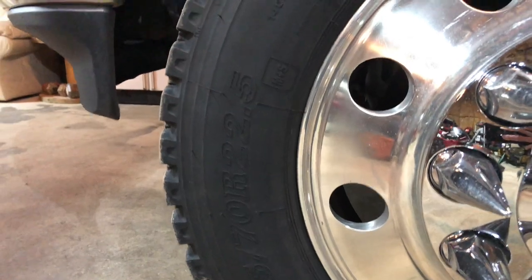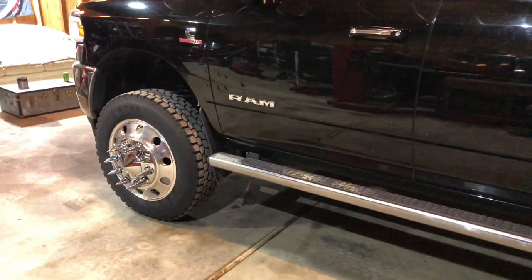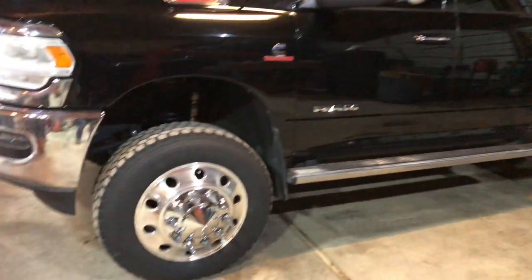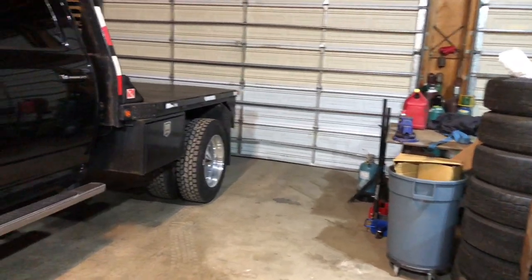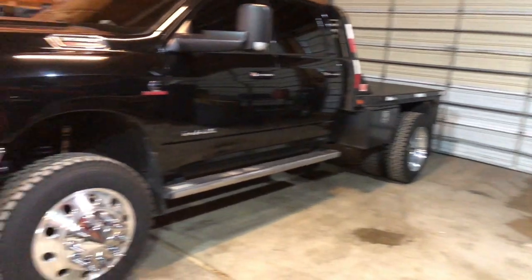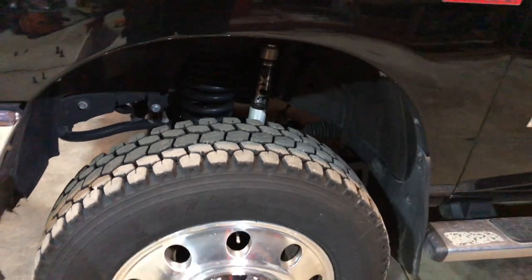What size tires are we going with? The 255/70 R22.5 18-ply — these are some heavy-duty tires. If you're blowing out an 18-ply in a 3500, you're doing something crazy. One reason I opted for commercial grade tires is I was tired of putting mud tires on my truck every 20,000 miles on a 20-inch or 24-inch rim. Regular 14-ply tires aren't rated for heavy commercial use, and I pull a lot of weight and put a lot of miles on my trucks.